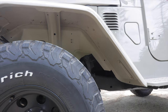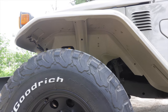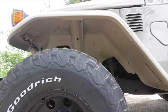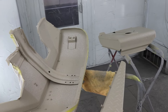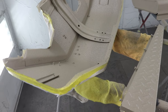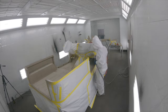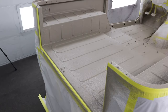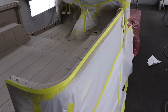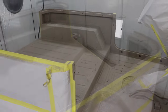That leads to another good point. When we do these trucks, we spray Raptor liner up underneath the fender liners to help ensure that if something gets kicked up, it doesn't dent the fender from the inside out, because there are no fender liners in these trucks. Primitive, rugged, old-school trucks — how trucks should still be made. The truck had a black spray bed liner before, but when we changed the color, we did some rust repair inside and sprayed a color-matched Raptor bed liner to match the exterior.